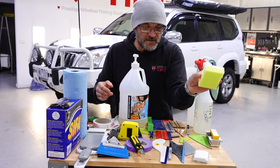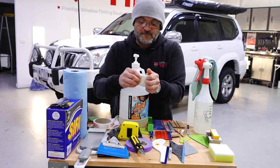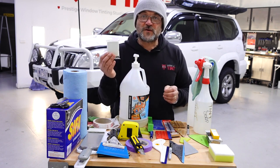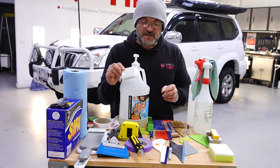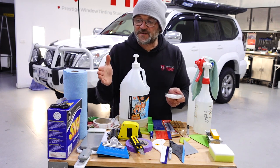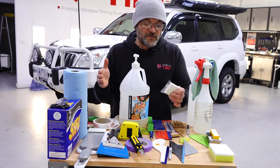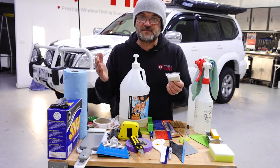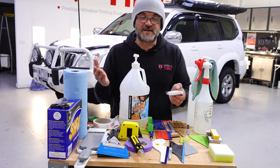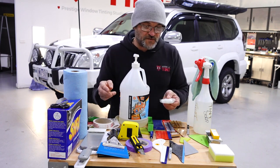You'll need a sponge to scrub the windows clean. This is a very good tool — it's a clay bar. Occasionally I use it for cleaning rear screens on the demisters; it saves you from using steel wool. Steel wool is still a necessity at times, especially for removal and refit, but more often than not my go-to is a clay bar. For stubborn demisters that are gunked up with contamination on the bars from over the years, start with the clay bar and if that fails, use steel wool.